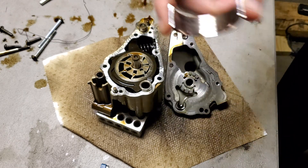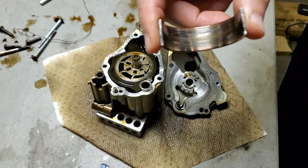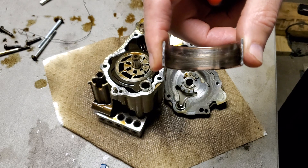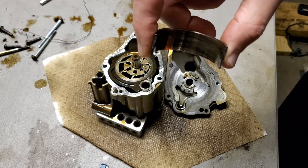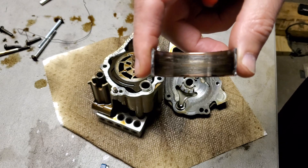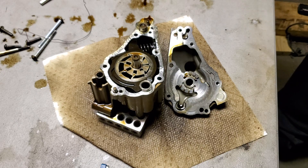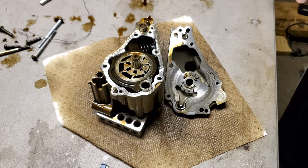The first thing to understand is that the width and diameter of this bearing is very similar to those on old-school engines from the 1960s, 70s, and 80s — there's no real difference. The clearances aren't substantially different either, and the bearing materials are not that different. And those older engines get turbocharged to a thousand horsepower — we're talking about the 2JZ, the GM LS engines, and so on. So what's different about BMW? Well, there isn't anything different about BMW.